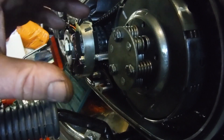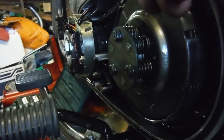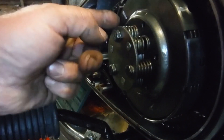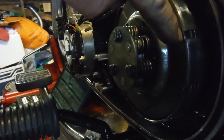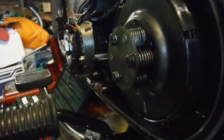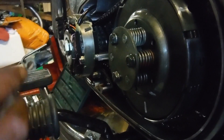Quite a few trial assemblies have been done to get this as good as it is. I'm going to spin the clutch with the rear wheel in gear, with the clutch pulled in. You may see some radial throw because this isn't perfectly concentric to the center of the pressure plate — that's just how it was made. But you'll be able to see through the clutch basket and see the edge of the pressure plate spinning very, very true. Clutch pulled in, let it out, put it in — we've got nice even lift all the way around that pressure plate now, rather than one part lifting and another part not.